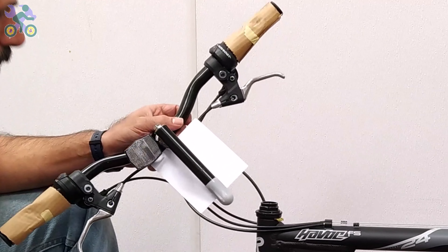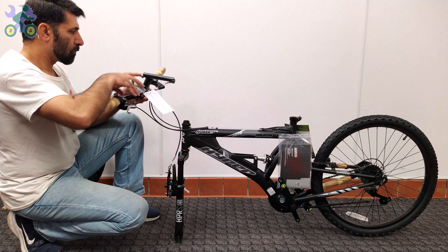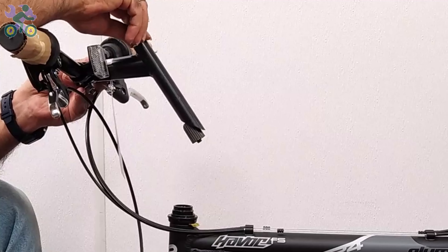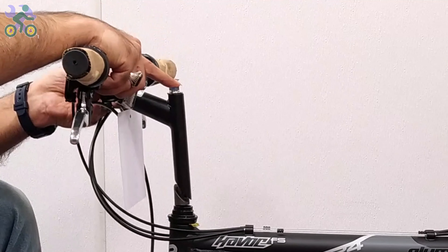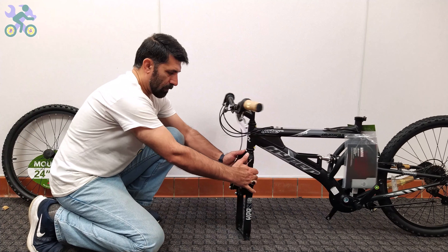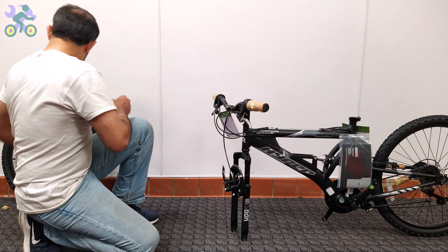Remove the plastic cover from the end of the stem. If it's difficult to remove, unscrew the stem bolt and remove the plastic. To determine the correct direction, turn the fork so that the brake system is facing forward. Place your finger on the stem bolt and insert it into the head tube. If it doesn't fit, loosen the stem bolt a little and try again. In rare cases, if the hole doesn't align properly, use an iron file to slightly open the head tube. Remove the brake knob or brake noodle, or for caliper or V-brakes slightly loosen the brake wire anchor nut if present, then remove the plastic piece from the end of the fork.